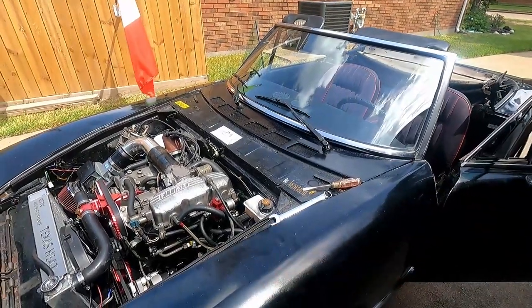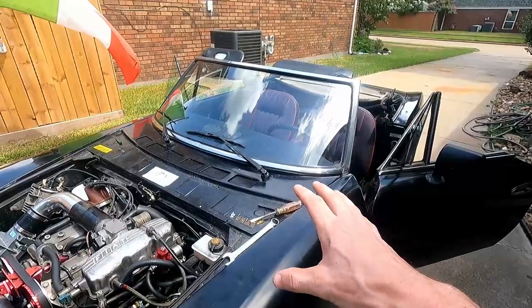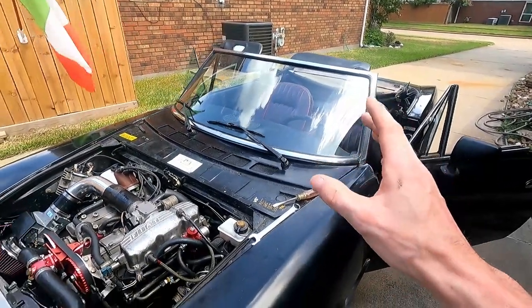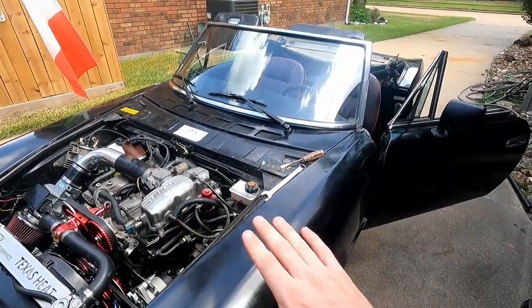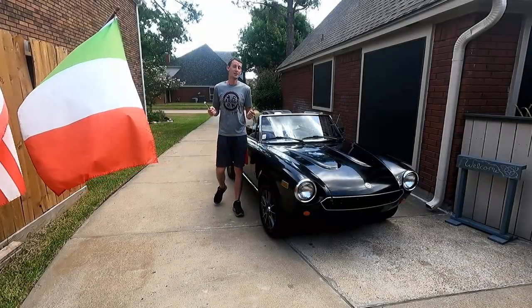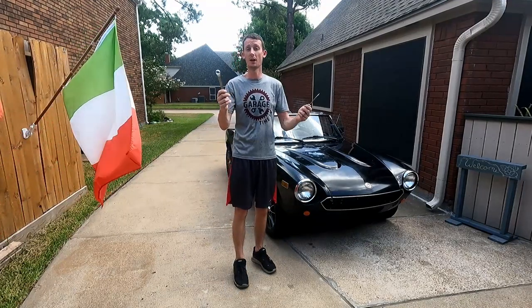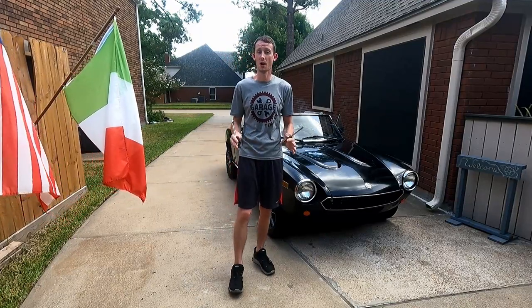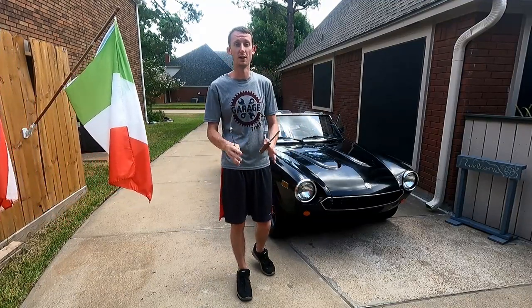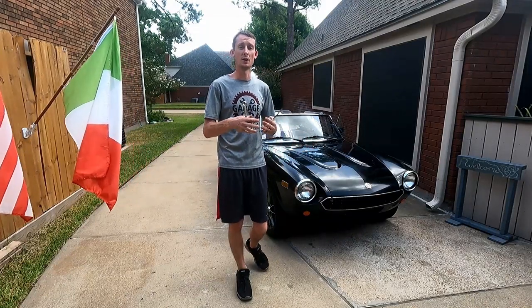It's nice and tight and we're going to go do a test drive to make sure that's sufficient. If it's not as tight as I want, I can still tighten it up a little bit. Like I said, don't over-crank it because you will break it — so if it feels good and responsive, leave it. With just a 19 millimeter wrench and a flathead screwdriver, we can adjust all that slack out of our steering and make our driving experience that much better.